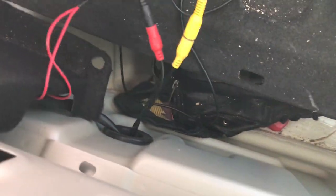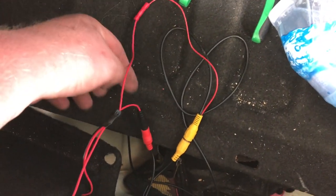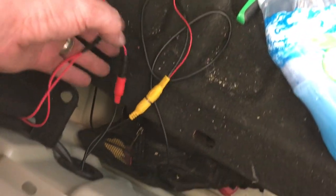We've got our video wire plugged into the camera now. This red wire connects into really the power of the backup light and the ground. Remember, we ran that all the way up and plugged in the power wire as well to the camera. We're going to clean that all up, put this panel back on, put this all back together, and do a final result.